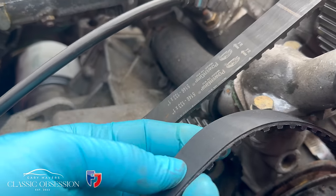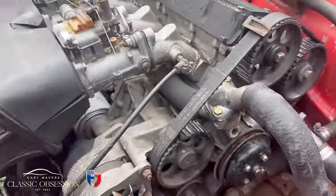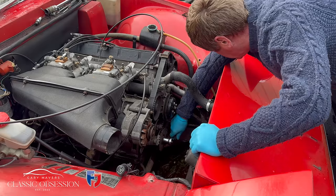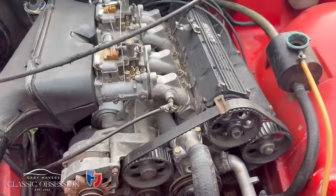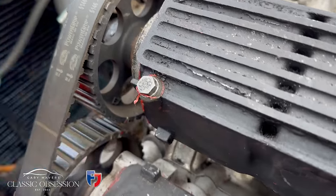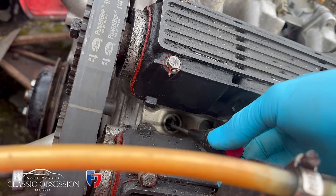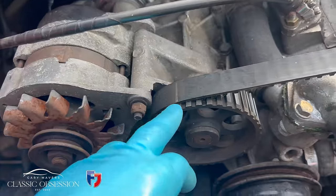Comparing the belts — the Gates one already on versus the Lotus one — even though the video doesn't show it well, you can see the Lotus one is slightly thicker and more robust. I'm turning the engine clockwise and insert a screwdriver into the number one plug hole. All the marks are lined up at top dead centre, both pulleys lined up. I also check the reverse mark, and the previous owners have marked them in red so they line up. The mark on the back of the distributor pulley is also lined up with the edge of the aluminium. You can feel with the screwdriver that the piston is at the top of its stroke. There are some lines on the belt that seem to line up with the marks on the pulleys, but I'm going by the marks that I know.